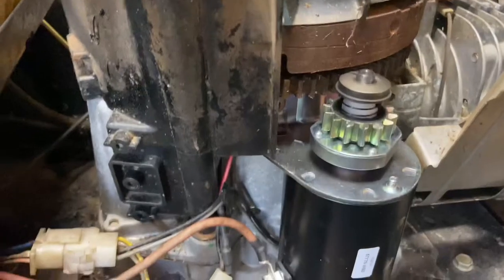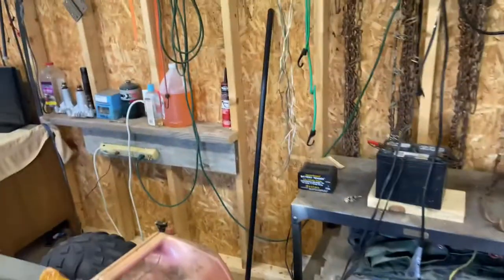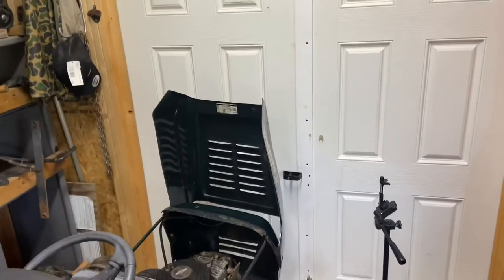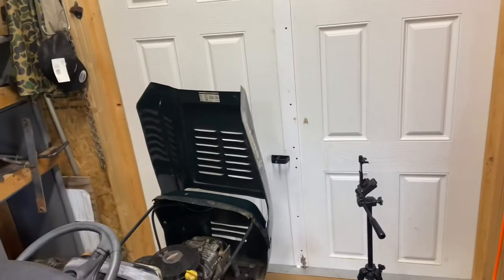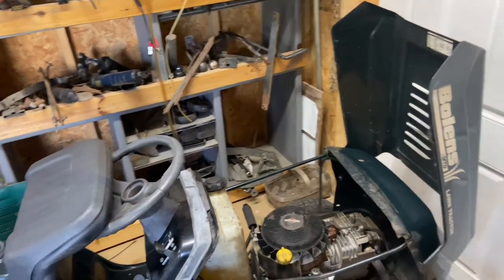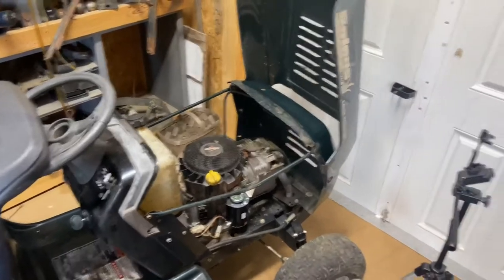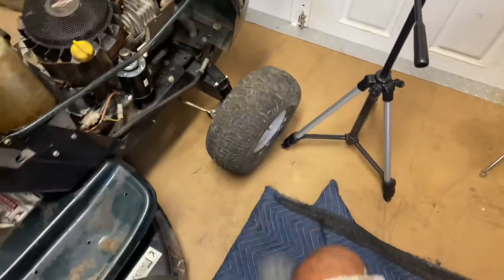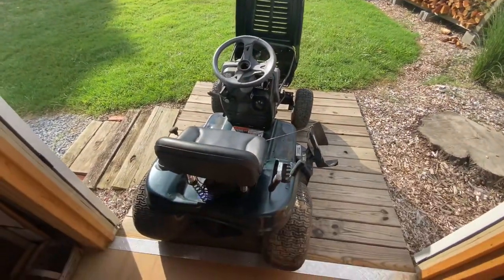There it is — 14 tooth, everything's tight. This battery is supposedly one year old. I'm gonna put it on and see if it'll turn over. Another tip — I'm putting this thing in neutral and opening up my doors. I've had these catch on fire, because I'm gonna spray carb cleaner in it just to jump it off. I've got gas in it, but I haven't checked the carburetor — that's probably what's next. I pushed it out on the back porch because I've seen these things catch on fire.